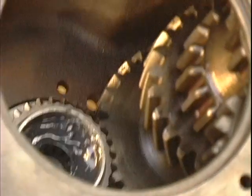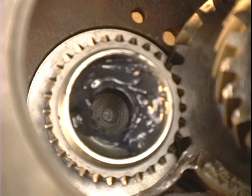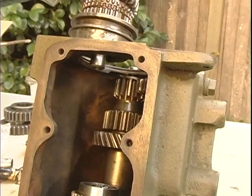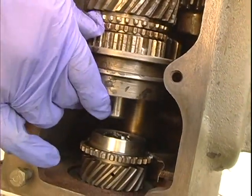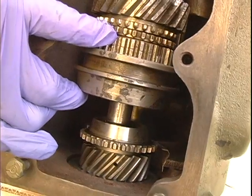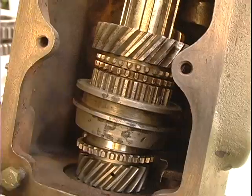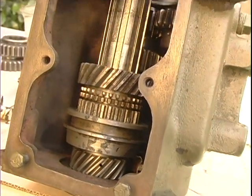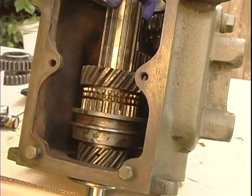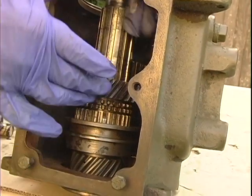Okay, it's holding that. Then we take it out. Now the dowel pin is gone, and all those little needle bearings are held in their place by the grease. The next step is to drop in the main bearing into the slot. And it goes in there very carefully. And it's in. That's the hardest part. Got him in there. That's how easy it is.